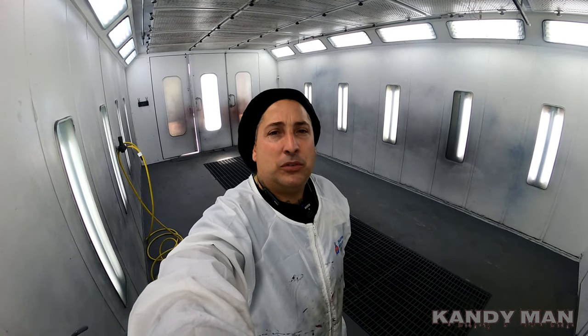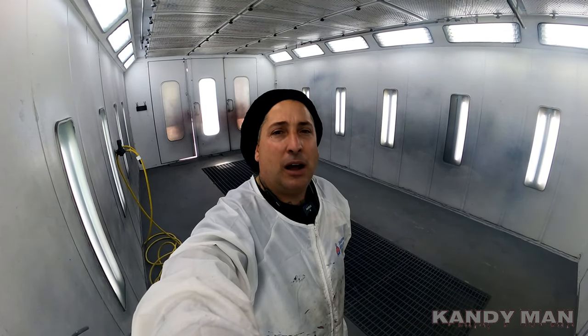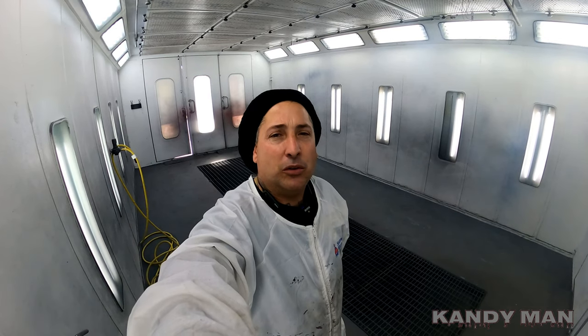So through the years, I've sprayed cars out of booths, in booths, and I've always got different clears for each situation. That way I was set up with the right clear and the right thing for the job. That way I could have the best looking job and have the best results, because each clear has got a different thickness, different solids, and they'll work better for you in different climates and different atmospheres.